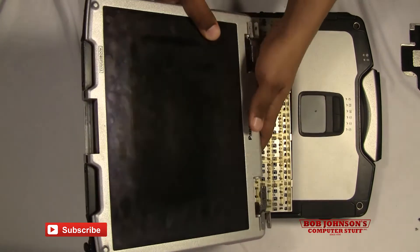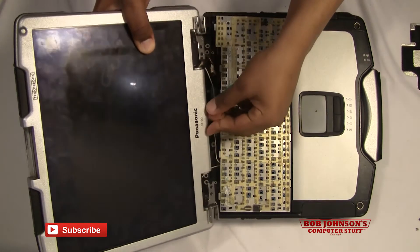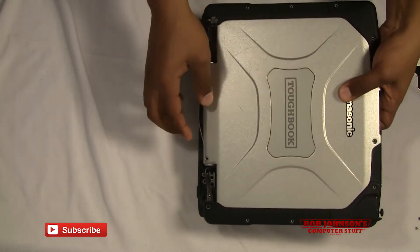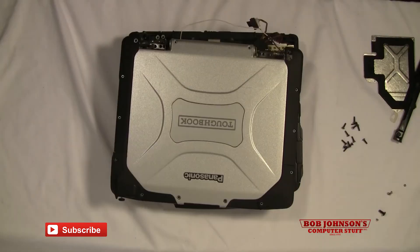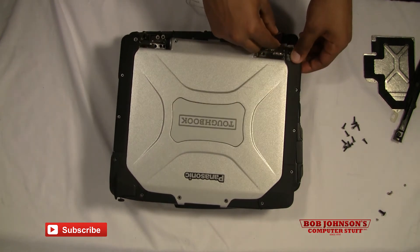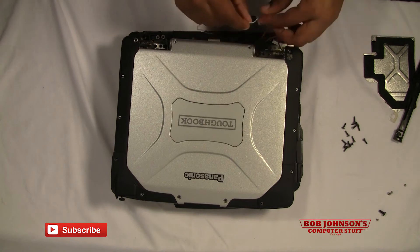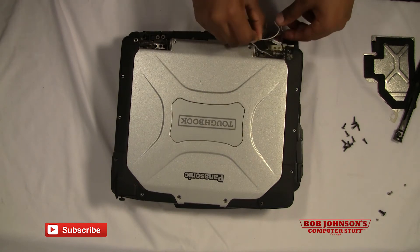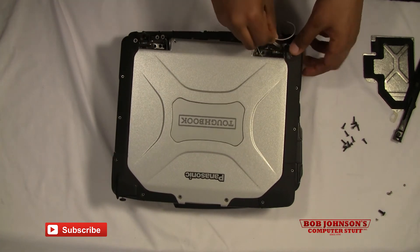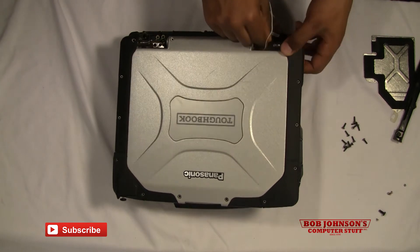And that's pretty much it. Once it's laying in the right spot it kind of all just falls into place. Now we're just going to replace the screws on the rear cabinet. Just to be on the safe side, you might want to run the wire across like so — make sure it's in front of the hinges. That way when you replace the hinge covers it saves you a bunch of confusion. Make sure the wires are run in front of the hinge covers for the Wi-Fi antenna, which saves you some trouble in the end.